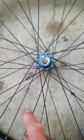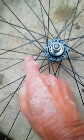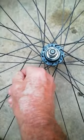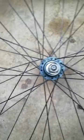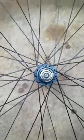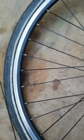The latest two to snap are here — that one and that one — at the flange end of the spoke, not the rim end.